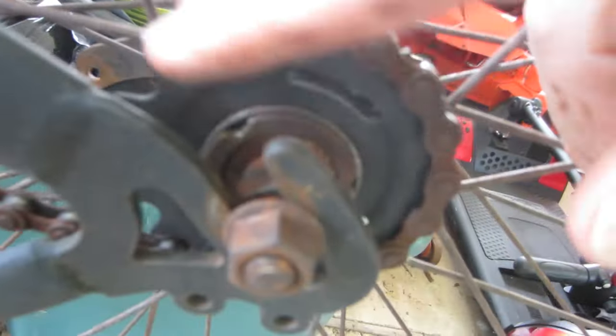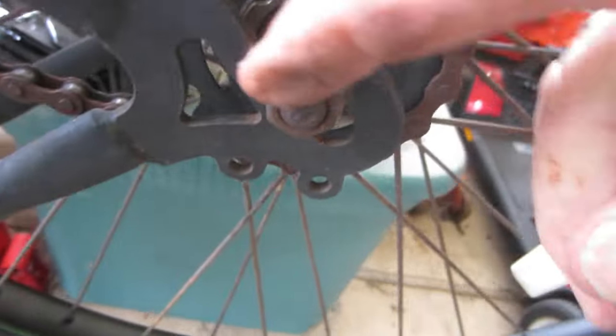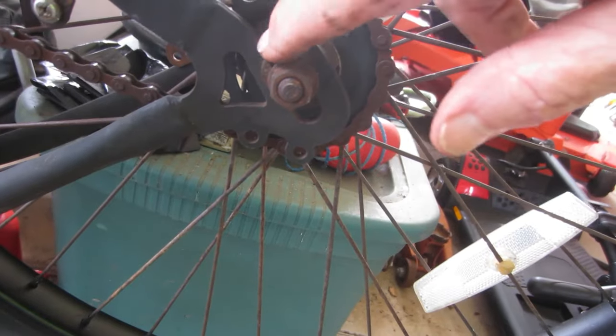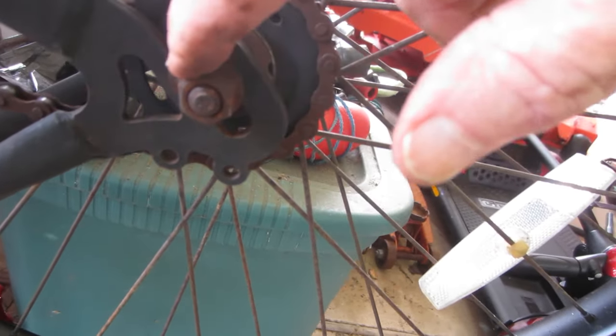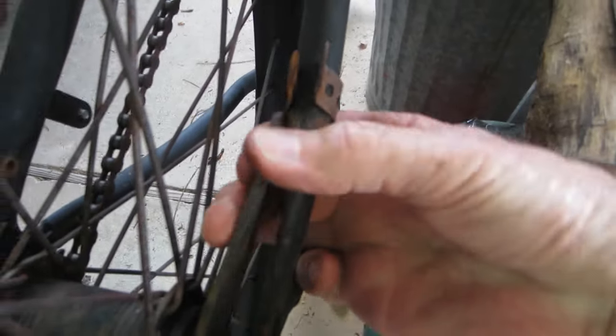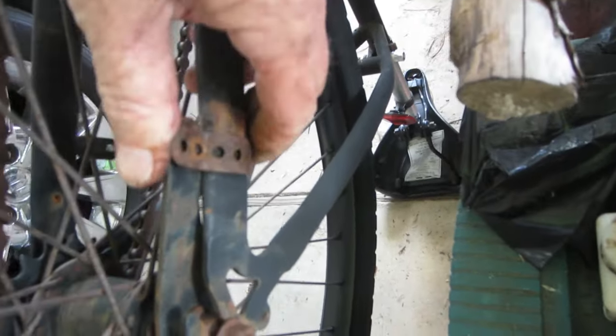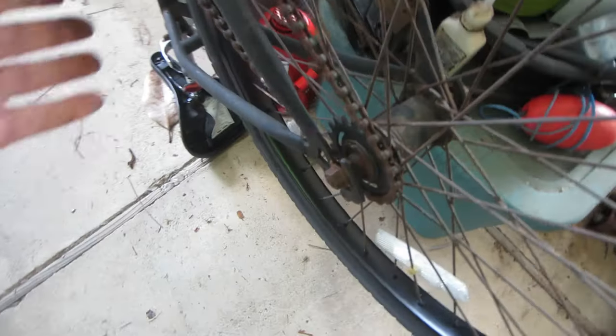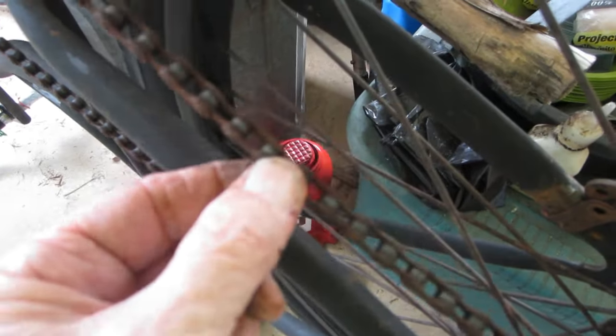With just changing one tooth here, it's almost like there was really hardly any change. So you could change one or two teeth probably. It looks like my adjustment is only going to be less than a quarter of an inch compared to what it was down the groove. I'll just tighten those two nuts on the end. And I've got my brake — if you don't have that in the right place sometimes it'll be a little difficult. The brake will go on here, and I've got a little bolt that goes in here. Then I'll tighten my axle up and leave just a little bit of play on the chain.